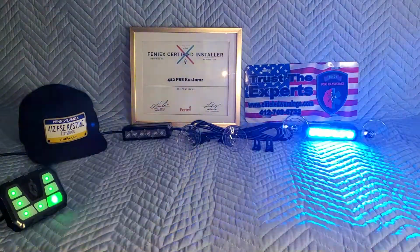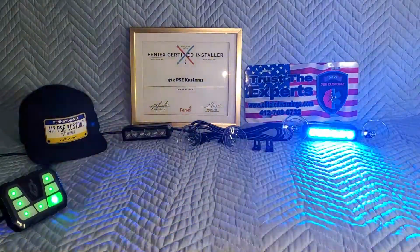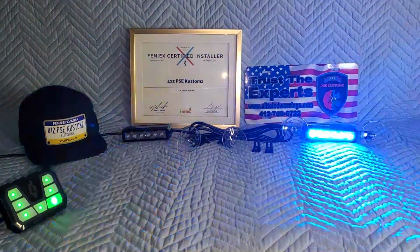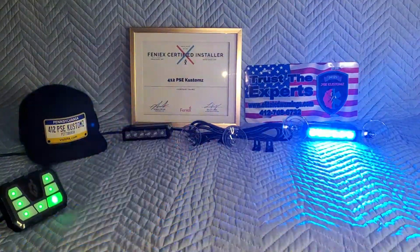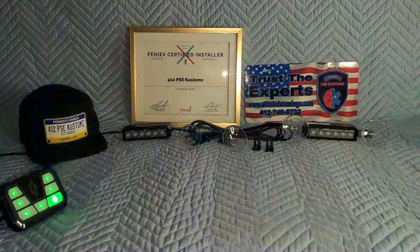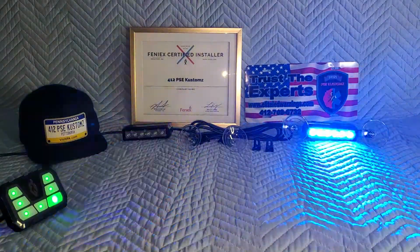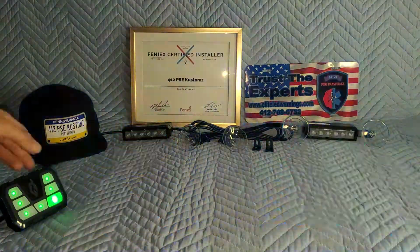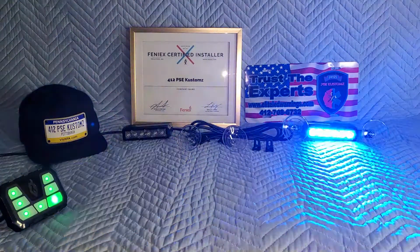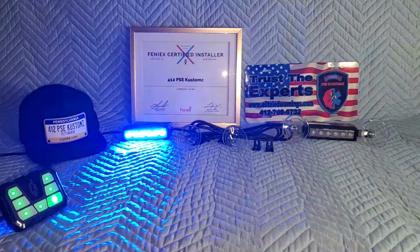Those of you that have not installed or programmed any of the Fusion light sticks, they use a ground signal to change the pattern, and the 4200 gives out a positive 12 volt signal. So what we did, and what we always do for these, is add an automotive relay in line. How that works is every time the 4200 momentary button is pressed, it engages the coil of that relay, which then changes state and grounds out that flash pattern trigger.